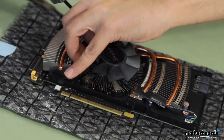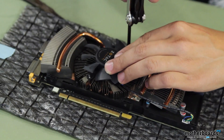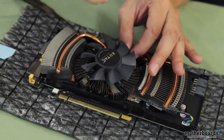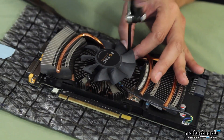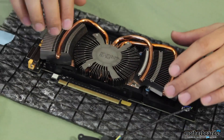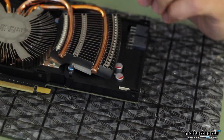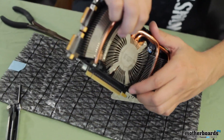These are somewhat difficult to get to because the fan is in the way. Basically you just want to remove anything that looks like it's going to be in the way or hinder you from removing the heat sink. What this is here is basically your fan controller — just go ahead and remove it. You're of course not going to need that if you're water cooling. So that gets removed and all you're left with is the card and the heat sink.